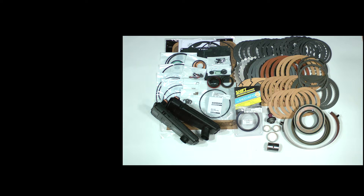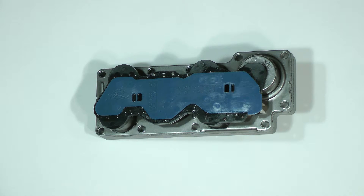But you will need something else to complete the recipe: electronics. All five solenoids which control this transmission are contained inside one large housing called the solenoid pack, and it should always be replaced. There are three different ones to choose from depending upon the transmission model year and whether you have a gas or diesel engine. I strongly encourage you to buy a new one, but if you are on a limited budget, remanufactured ones are available at a lower cost.